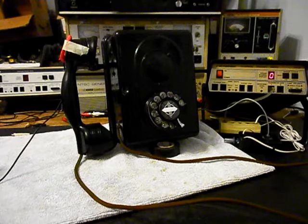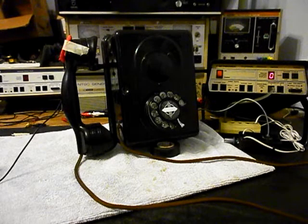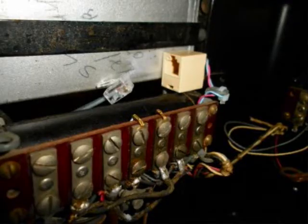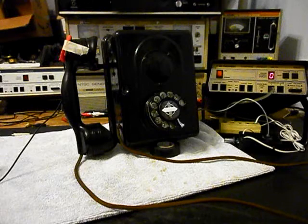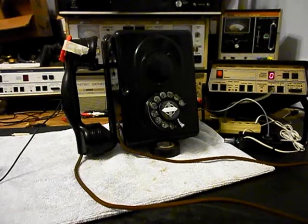We went through the wiring blocks and made sure everything was proper and tight. It had a small wiring issue, so we took care of that. We also installed a modular port so that John can simply walk up to this telephone and plug in any length, any color line cord he chooses — that makes for a simple, easy plug-and-play connection. Everything was kind of loose in the telephone — the mounting screws for the bell, the coil, and the rotary dial — so we tightened all the brackets down and all the screw connections.